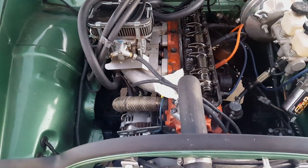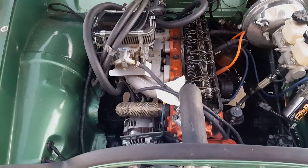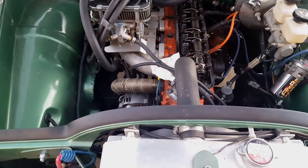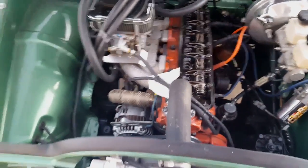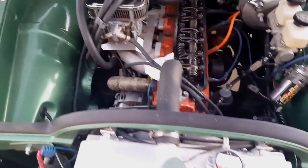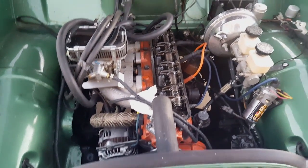IPD's video is just so informative — the one about valve adjustments. I forget her name, but there's a nice lady doing the instruction on Brian's 142. It's a '69, it's a B18, same as mine. 16 to 18 thousandths — I'm setting everything at 17, just to be right in the middle. All of my clearances are a little tight, however.